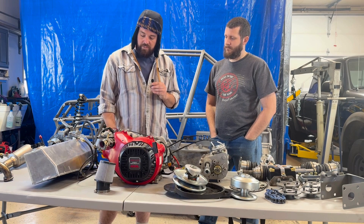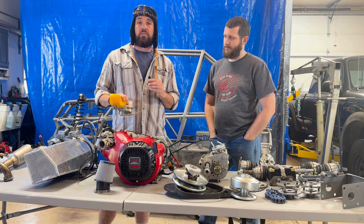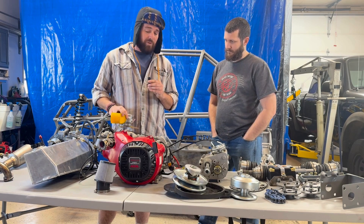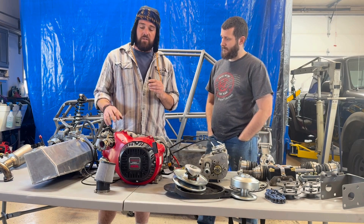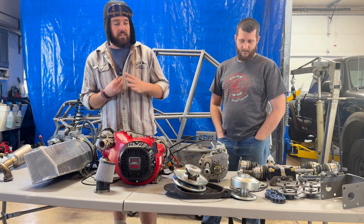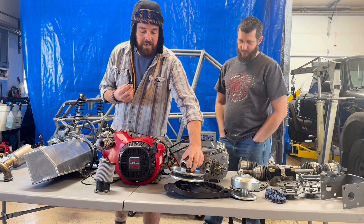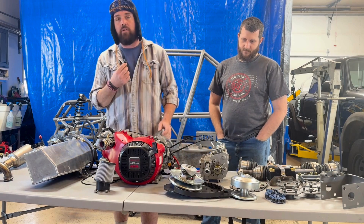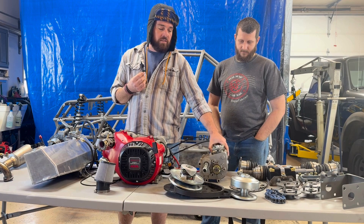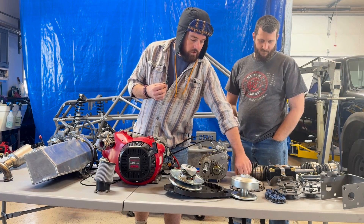Carburetor-wise, the Mikuni is a great option. You had 3D printed this curved intake adapter — it looks great, and honestly it works, but it's going to have to be changed in the future. We're going to get this thing assembled in this series and fix that later, because it runs better than it did before just with the carburetor increase alone. Another thing to keep in mind: this is the series 40 clutch. It looks like a Christmas tree — that was a learning curve — but double-springing it up gives it enough tension that it won't move at idle. So series 30 CVT, series 40 forward-neutral-reverse box, and we talked about gear ratio: two-to-one, with a final output of four-to-one with the sprocket.